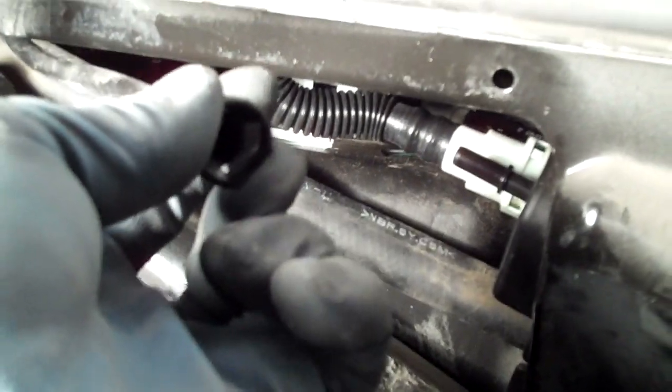On that white one, there's a little clip in the middle of it. You got to pull the clip all the way out of the plug first. And then there's also one on here that's either gray or purple. You got to pull it out all the way also. So here with your evap lines, you can see that they've been pulled off. This one's got the push button on it where you just push the little end piece here and it causes it to unbuckle. Other ones are like this where you have to pinch the outside so you can see where the little squares are. You just pinch those to undo them. See, for this one you just push in the button. These are the kind I like.